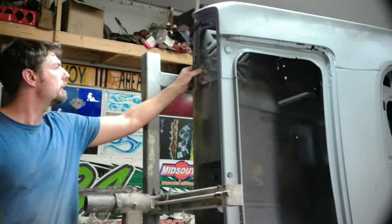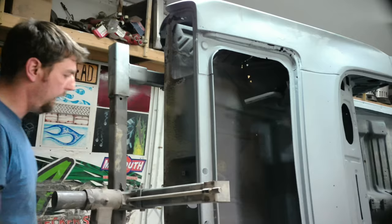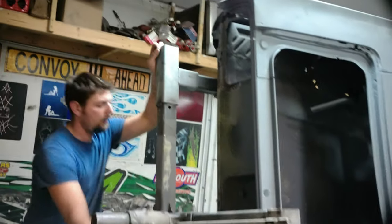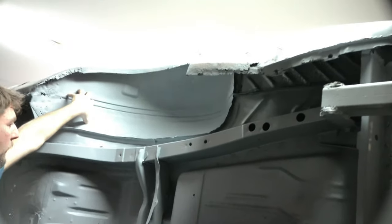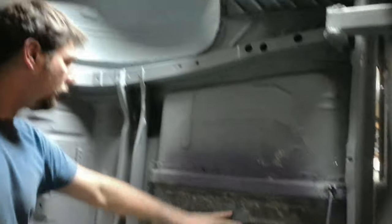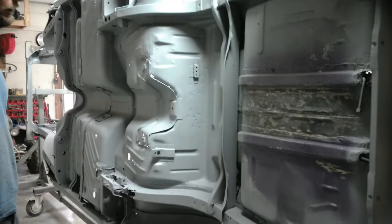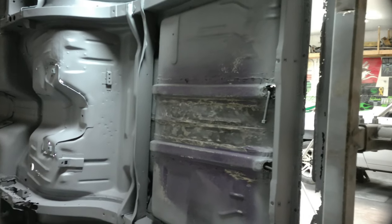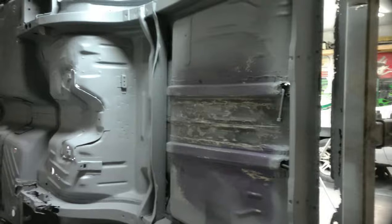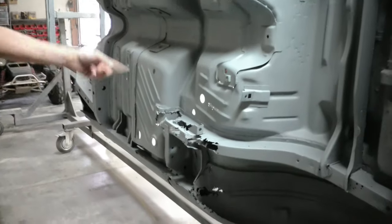The whole tail panel is going to come off — there's not too much left of it. Another reason we can't leave it on the rotisserie is that when the tail panel comes off, this piece is going to be in the way. Taking a look at the bottom of the car, you can see why we need quarter panels — probably going to do inner and outer wheel wells. When we got the car, they had a lot of undercoating on it. It looked like they knew the kind of work they did and tried to cover it with bondo and undercoat. When you sandblast the car, you get the true colors of what it is. Obviously the frame rail is ate up — we knew when we got the car that it was going to need a frame rail section.